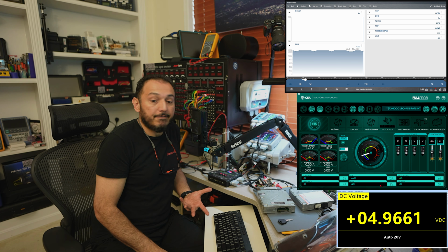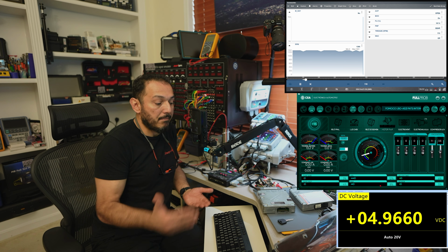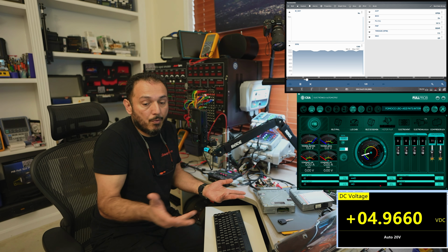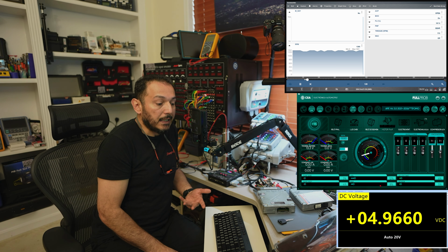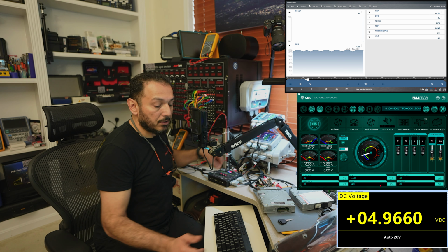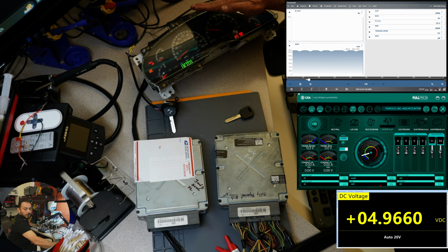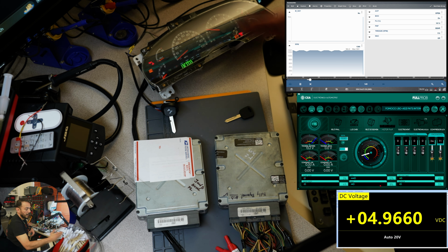And the reason they're not firing is because I have not done the parameter reset on this computer. I can do it really quickly, but I know that works. But as you can see, I can read on the instrument cluster, I can see RPMs. I'm going to cover that light so you can see that well in there. So we got the RPMs in there, and we can see the response from the computer by the spark. So that is a good working computer. So definitely, J&D, Dean, I can definitely reproduce the concern.